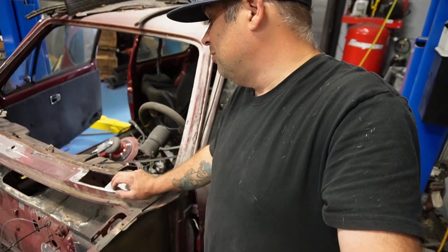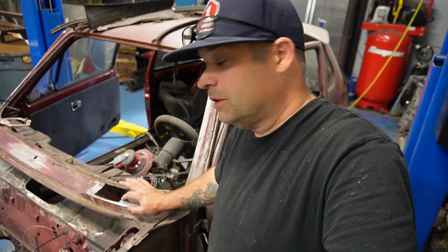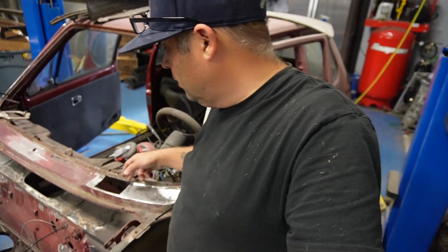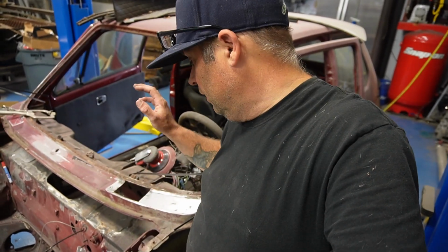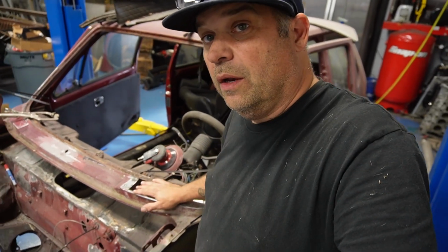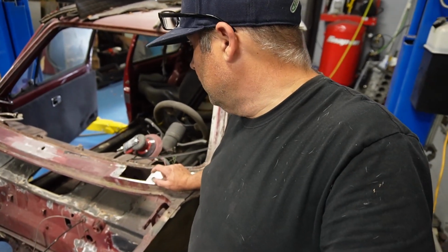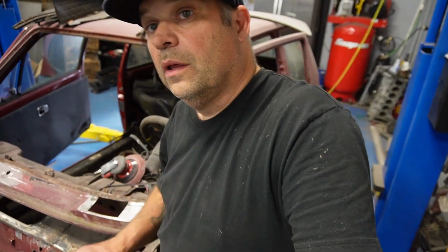This side is a little different. They welded this, but only tacked it and panel bonded the rest. Because they didn't prep it correctly, the water got underneath, rusted everything, and the panel bond lifted. Not a very good way to do it. But this one's a little harder because this is curved. So if I bent it in the brake, it wouldn't be correct, it'd be straight.